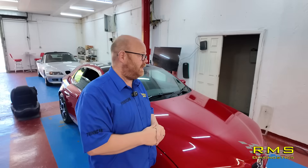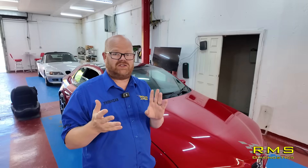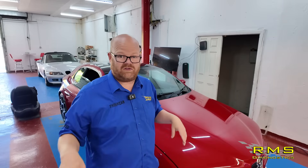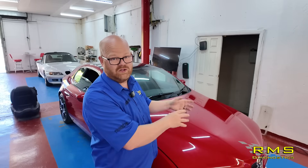The customer complaint is the rear seat adjustment is not working. It's a manual seat on everything else - no memory seats, nothing. It's just the back that goes up and down electronically with one switch. He's already had a look himself - changed the control relays under the seat, swapped them about. The passenger side works, driver's side doesn't. He swapped the switches around and still the same. Everything from the driver's side works on the passenger side but the driver's side is still not working.